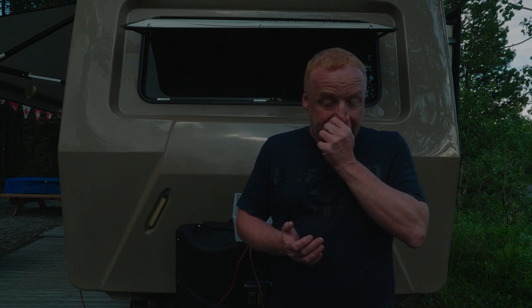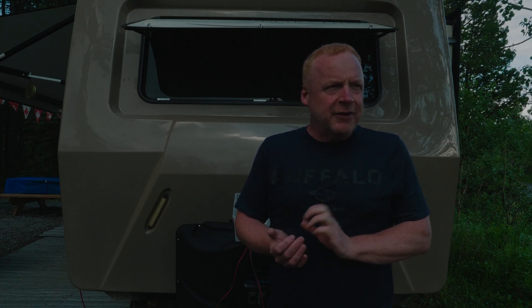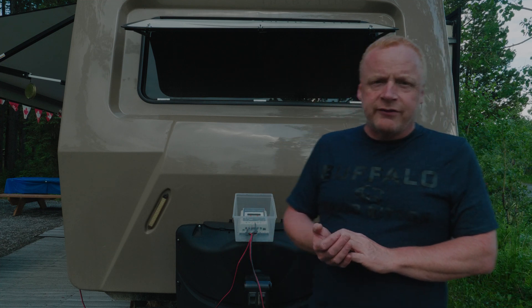Keep in mind when charging your batteries with solar, the amperage coming in is rated on amp hours — so if you're getting 8 amps, you need an hour to put that into your battery. During the day we minimize our electric use inside the trailer and charge our devices while the sun's shining. At night we don't use the lights unless we need to grab something.